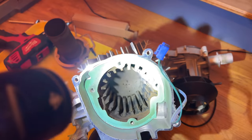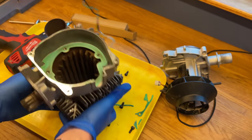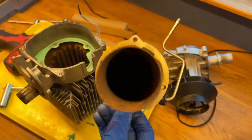Overall I'm extremely happy with the heater and how it looked inside after 2000 run hours - it was actually pretty clean. I don't know if it makes a difference but I generally only use premium diesel because I get better miles per gallon and it has additives for cleaning engines. Up in the Arctic I was using winter grade diesel which people say can cause issues, but I've not seen any of those problems. Not all heaters are equal - especially Chinese made ones, there's a huge variety. I know people who've had them in for four or five years with no problems, and others who've never had them work from the first go or clog completely in the first few hours. That could be user error or just receiving a terrible version of the heater. If you want to watch other videos check out the Arctic trip playlist or other diesel heater related content - links in the description. Thank you for joining me, see you next time, cheers bye.